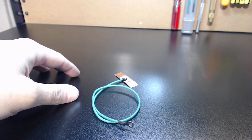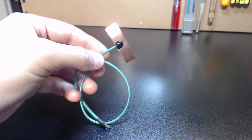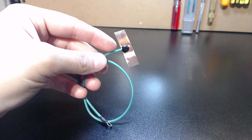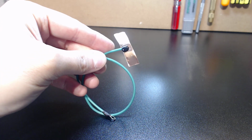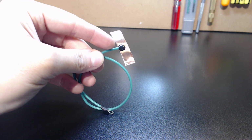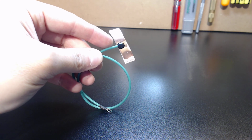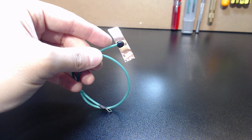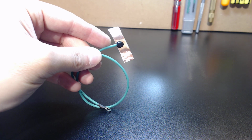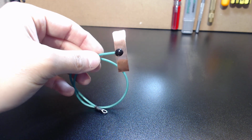I've used them for years, and again, it's just a question of which way you want to go. Now, one thing to keep in mind is that you can change this up in many ways. You can add more leads to this copper tape. I can build them that way. You can build them yourself that way. You can use tin braided copper, in different thicknesses, to give you an even lower level of resistance, because we're really giving the electricity and static and noise a way to dissipate the fastest. So keep that in mind.